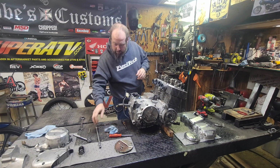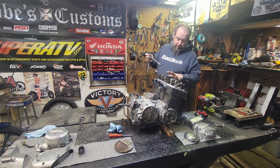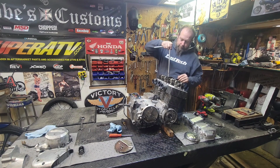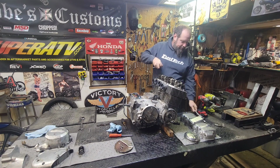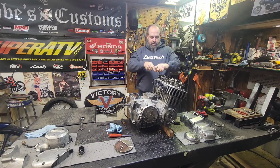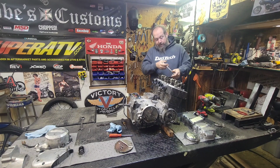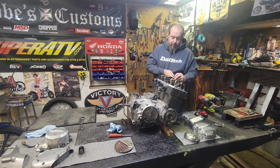Alrighty. We'll go ahead and pop these cam holders loose up here, and that will essentially allow us to move everything and pop the camshaft out, pop it off the cam chain, loosen it up here, and then we'll be able to slide the camshaft out, pop the head off. Get this big extension off here. Oh, and actually what I need to do too, since this thing does have overlap, I need to loosen all these valves. Get any of the rocker arms off the assemblies so that everything can move free when I pop this loose.